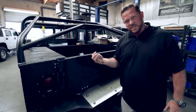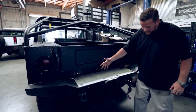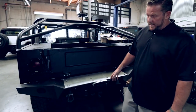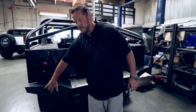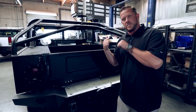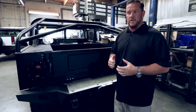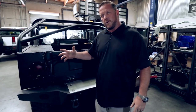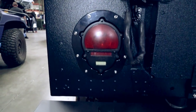We do that truck coat — it's almost like a finer grit for the texture finish. Bringing up the rear, we have our Viper rear bumper with a 24-volt winch from Warn. On the Humvee platform this is instrumental for having the integrated lights, which we're going to wire into the reverse light. We changed the shifter to have that reverse function — most Humvees come with a three-speed shifter that does not have park or a reverse light. All of our paint jobs also get the new taillight housing with that stainless steel detail.